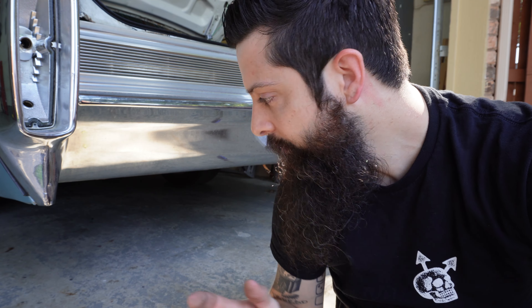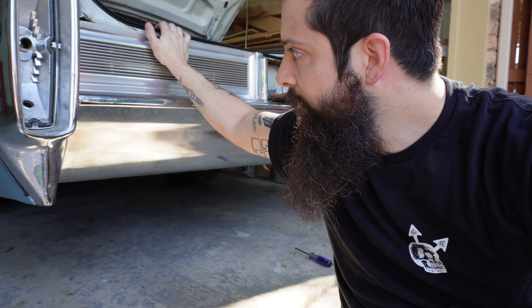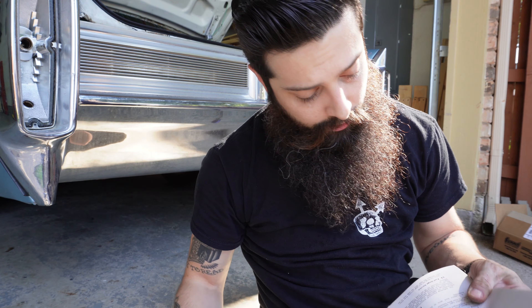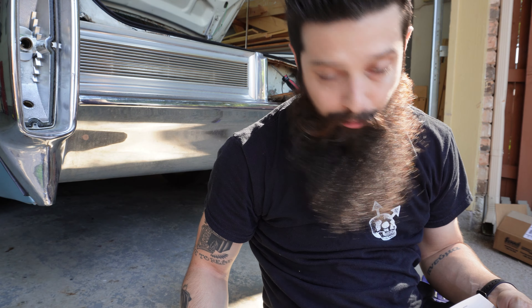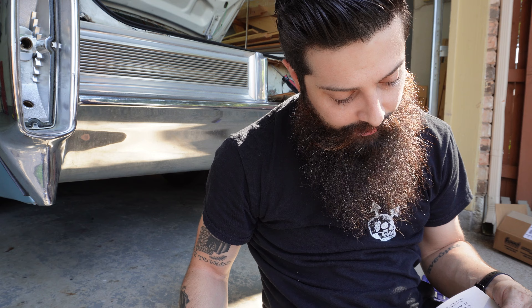Okay, I see the clips, but the wire is not attached, so that makes me think someone's done this before. I'm not going to mess with it. Next thing is to loosen the rear bumper mounting bolts and pull the bumper away slightly to gain access to the light assembly mounting nuts.